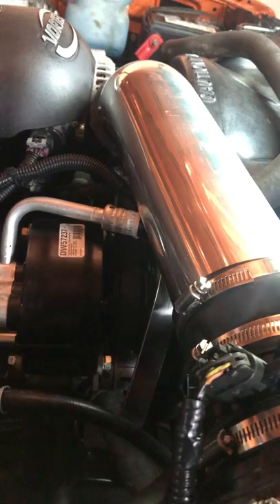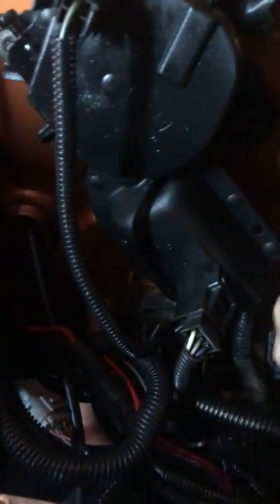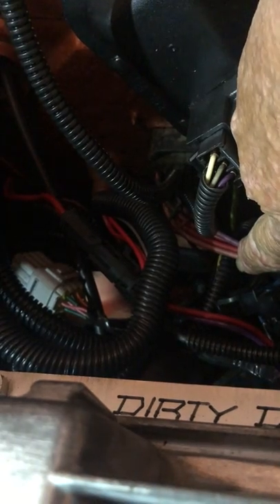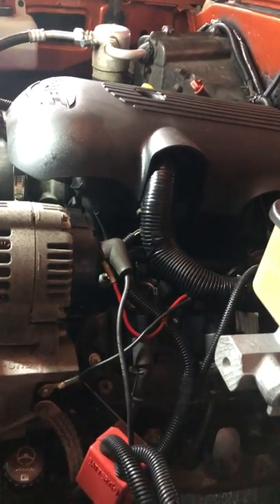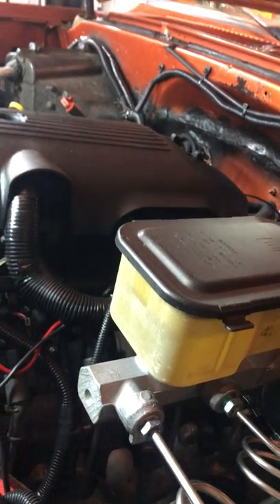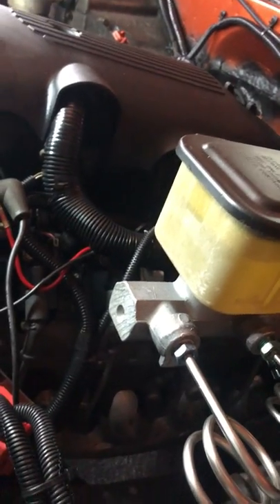A couple other things on the wiring harness — hooking the wires up for this is really easy. Keep your original harness intact over here. You don't have very many wires at all; it's just this top group. Your purple goes to your start wire, your pink is going to go to your key-on, and your red wires you're going to want to hook straight to your battery — that'll make your alternator gauge work. After that, you've got a green wire that runs over to your temperature sensor. I bought a temperature sensor that has a third wire on it, which allows you to plug in the ECM and also run your gauge inside the truck. Same thing with the oil pressure gauge — I bought an adapter that goes down by the oil filter, put that on, and screwed my factory 85 gauge into that.